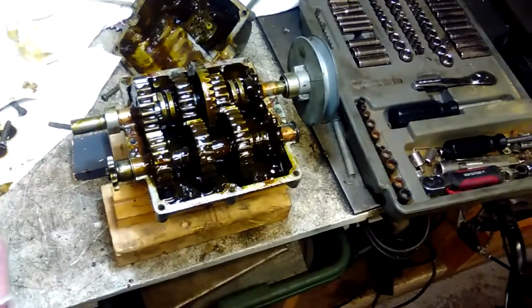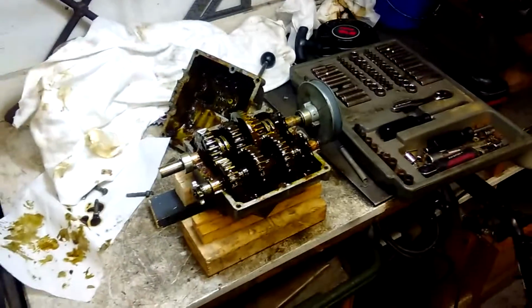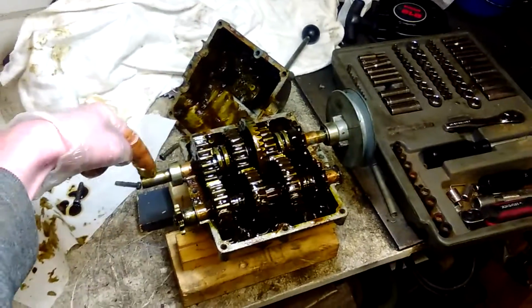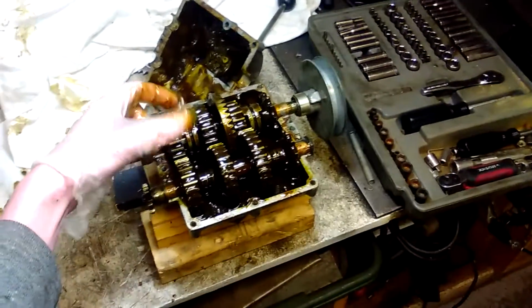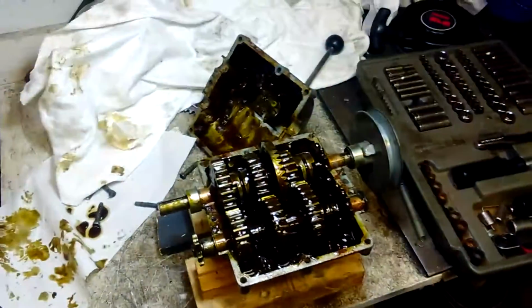If you try to get any more onto that, you mod a GX200, then you'll probably start breaking this thing. And then you need a better shaft here. You need to weld the keys onto this shaft, because that's another thing. You start dumping the clutch hard, you're going to open up the key slot. Hardened shaft is better too. Obviously hardened steel is better for that.